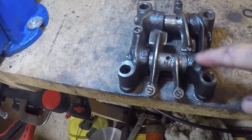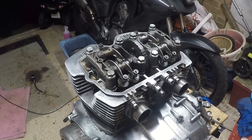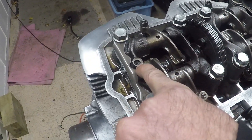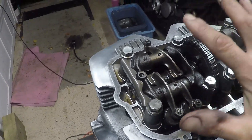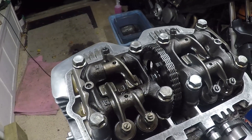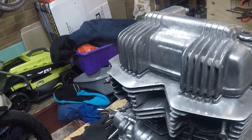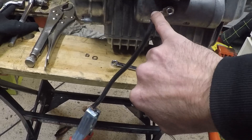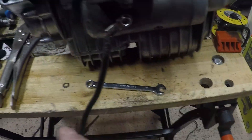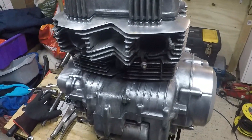So the head is reconstructed again with everything torqued down, using a different carrier this time with good threads and the better conditioned rockers. I'm going to give it a quick turn over - head on, rocker cover on, I think she's done. Just wrapping up for the weekend - covers back on, side cover back on. Also replaced the hardware on the high tension cable to the starter motor - that was all corroded and had little broken bits on it, but managed to get that off. New hardware now, all good. She turns over wonderfully, got compression pretty equal on both cylinders - I think she's ready to go back in the bike.